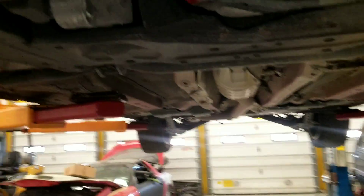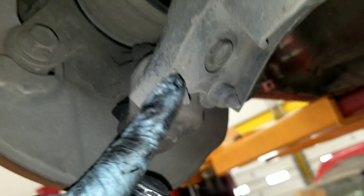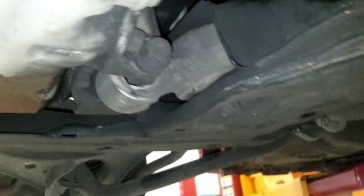This one — that one's with the motor mount. Yeah, we got a little bit of a leak, take care of that soon enough. Here's the other one, and then you have these here — you have to take those loose, loosen and remove. Here goes the other side. That's the lower control arm — take these three out — and the transmission bolts. You can see a little bit of the clutch. Support the engine, motor mount, and we're good.